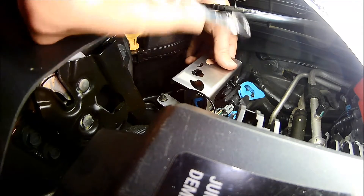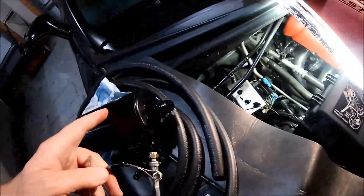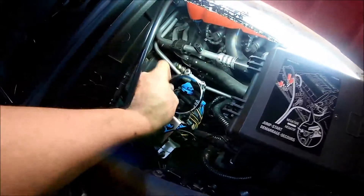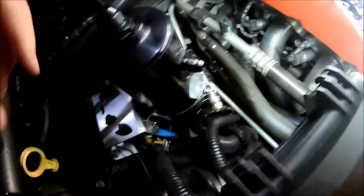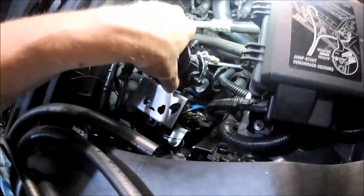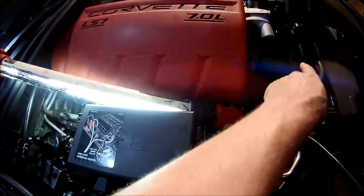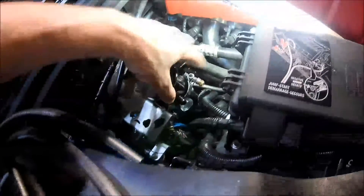The hardware they give you is good old 7/16ths. We've got to mount something round onto something square, so we need a mounting clamp. We've got a couple bolts and we're just going to put it right there. I've just got to slide this bad boy in here and cinch that bolt up. I installed it between this port and the view window to get it lower so the hood would close — we want hood clearance. I need to think about routing: going from the valley pan and then to the port off the intake. Cinching that up again with 7/16ths.